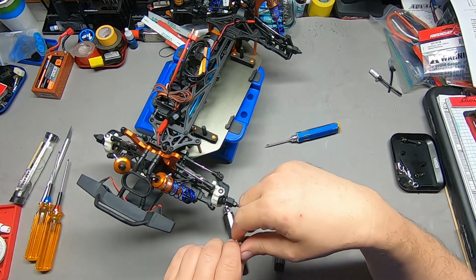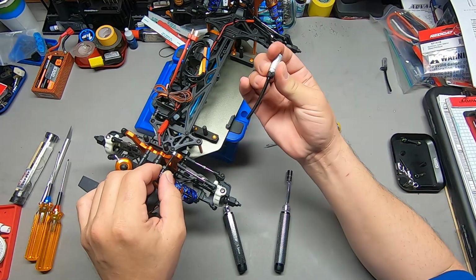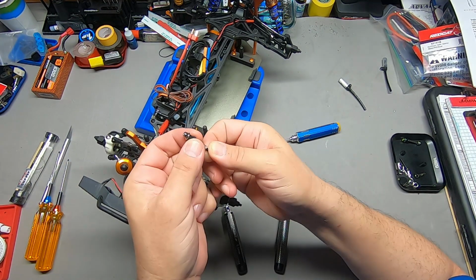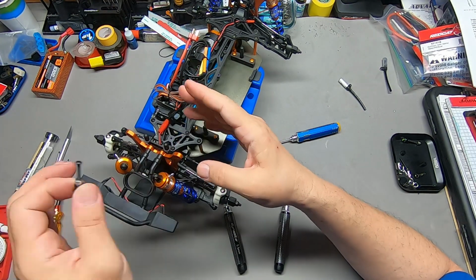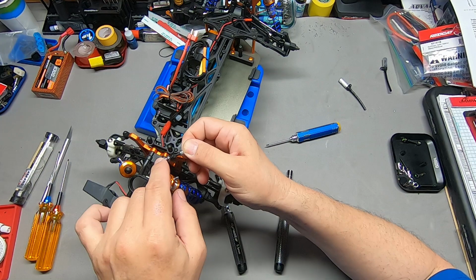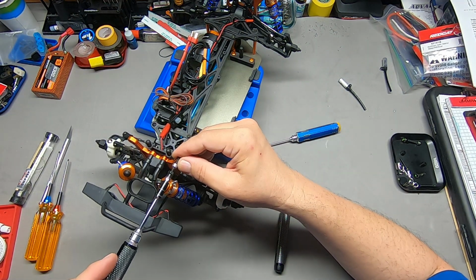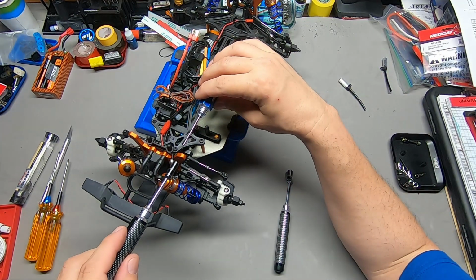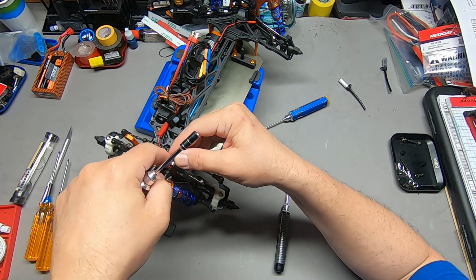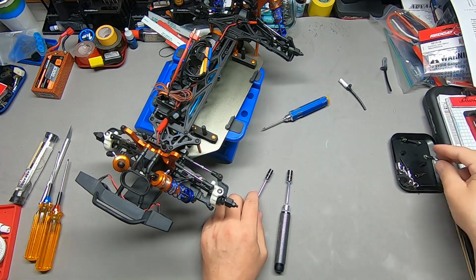Same thing with the ones that are on the rear of the body. Also, we don't need this spacer here. So between this piece of plastic and this spacer, I can use a considerably shorter screw up here. I'll also replace this plastic bushing thing up here. Well, I may not. But what I may do is just replace that with a couple of washers and an aluminum lock nut, and that way it's tight on here, so when you want to take the shock off for maintenance, you don't need to have a wrench at one end and a hex driver at the other. You just undo the bolt with a wrench and the assembly, the screw and its washers and lock nut, stays in place because it's firmly tightened on here. It's up to you how you decide to do that.